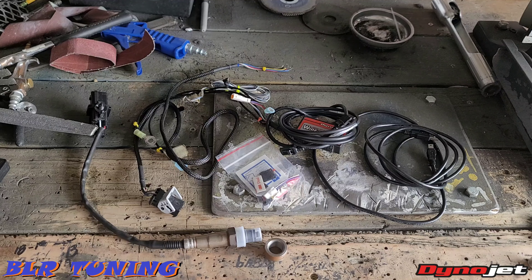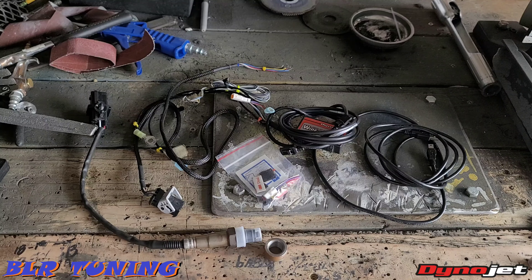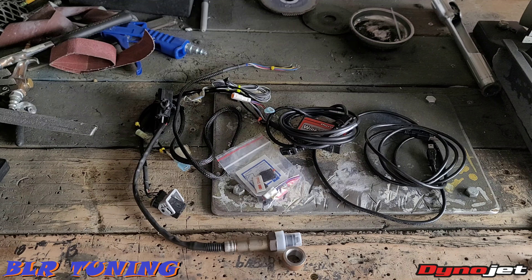So I'll go over the basics of the install and show you guys how it installs, and then I will probably bring it up on the computer and show you guys how to accept the trims from auto-tune, that type of stuff. It's very simple and very basic as far as how it operates — it's easy to understand. DynoJet has made it as easy as possible. What it does in the background is some very complex math and complicated things — it does it for you. You just have to accept the trim values and set your target AFR in all of your AFR charts on your fuel tables. So we will go over this install and get it all installed.